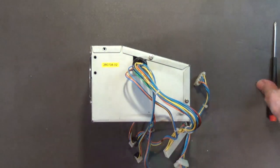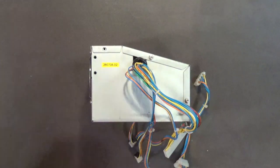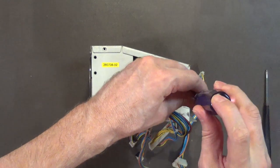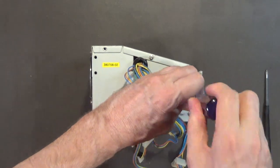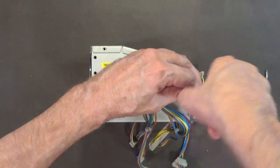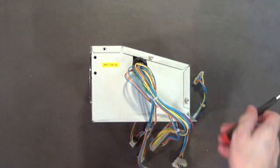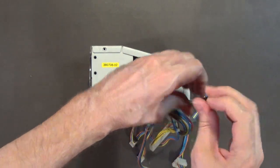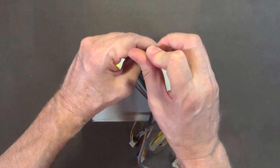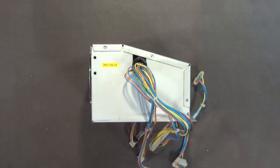When you take these screws out, put them back in the same holes they came from. I usually lay them out on the workbench in the same positions they came out of. You should not have to use the full-size number-2 screwdriver to put everything back together — only use it to break the initial seal on tight screws, then switch back to the low-torque driver.